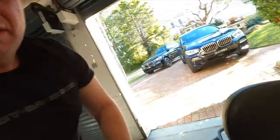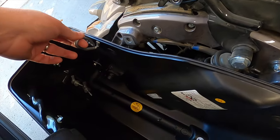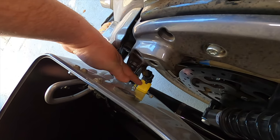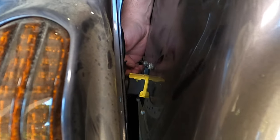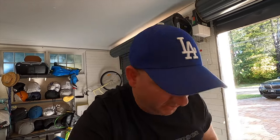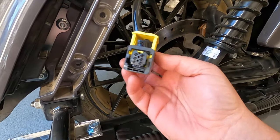You don't actually disconnect that connector directly. What you do is flick over and pull the bag out, leaning it up against something so it doesn't fall on the floor. Back behind there, this yellow piece is what you're looking for. Pull the top of it up — see that? And as you pull it up, bang — disconnected! See how easy that is. In reverse: push it in and pull the thing down to lock it. There's your Boom Audio disconnected.